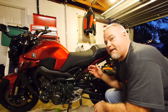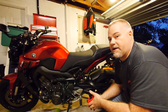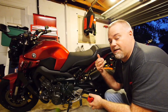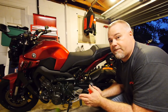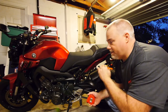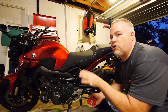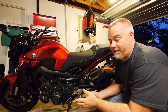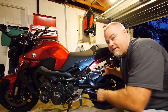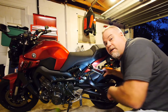That was about two full turns to get to 40mm. I don't know where it'll come out of the box for you — definitely check it and set it. I don't have my helmet or jacket on, which will make a small difference, so I wanted to be closer to the 42mm spec anyway. I'm right in the range. Now reinstall the set screw — certain holes are threaded, just look around. I've got one conveniently near the top.